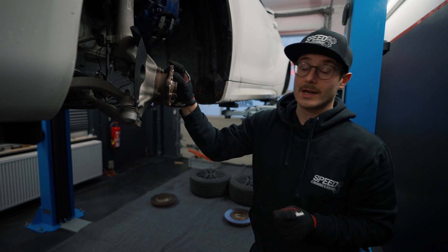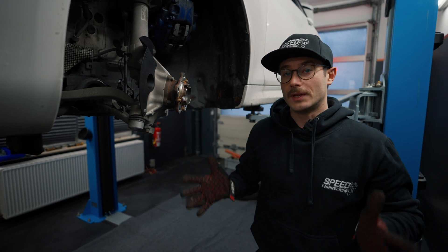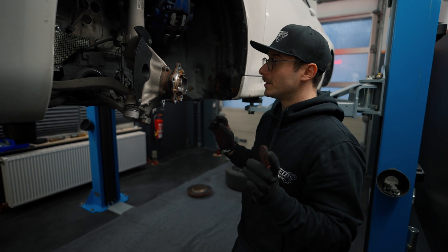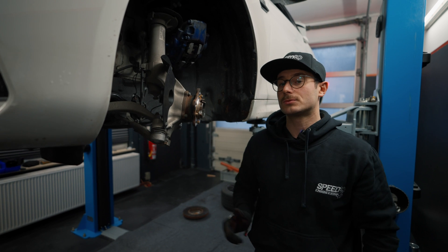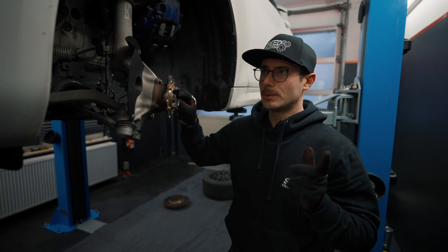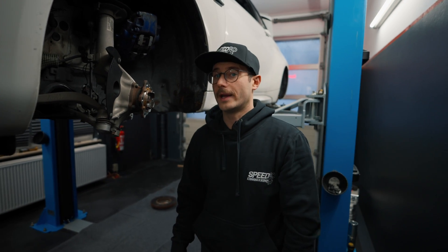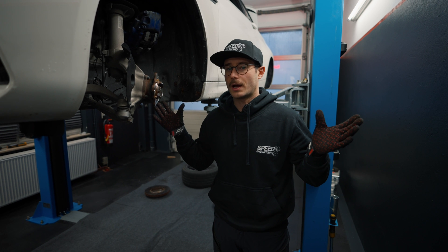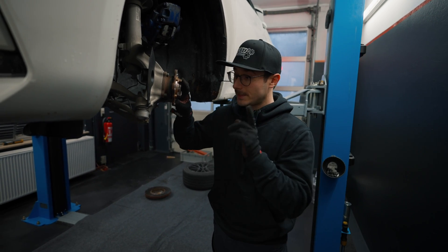That's the first thing, and I also have to mention something very important: a brake cooling kit is only and always an additional product. It is not the solution for everything. The main part you have to change is the brake pads. The brake pad in combination with the brake cooling kit is what makes the brake effective and durable on the racetrack. In this case we highly recommend Endless brake pads ME22 or N39S. The N39S has a longer temperature range but it's not as durable as the ME22. That's for the front axle.